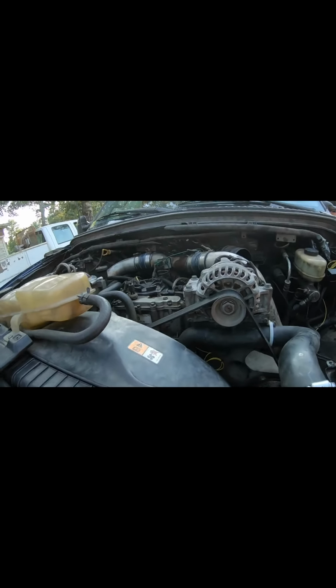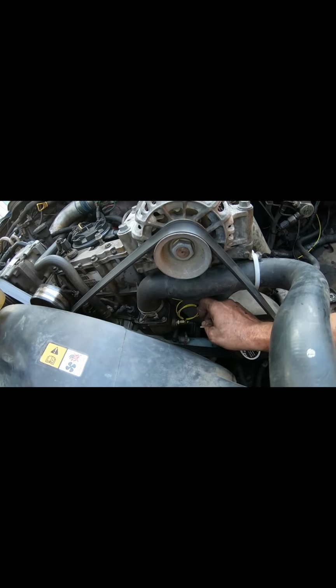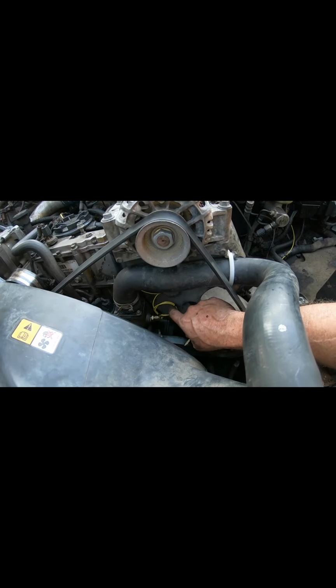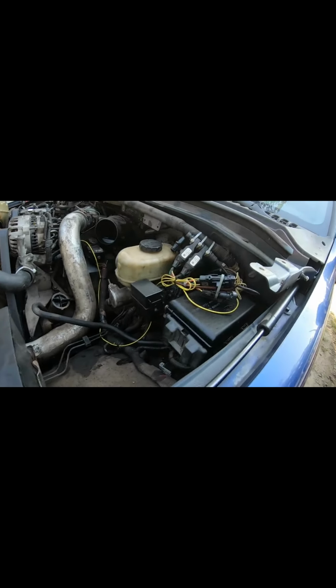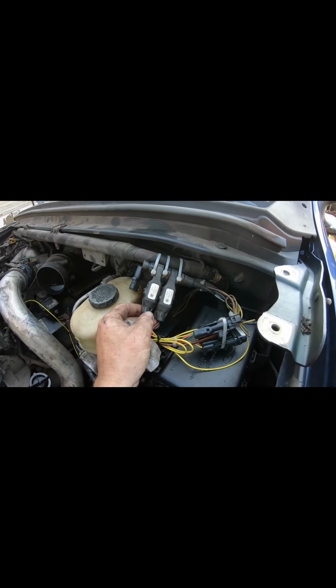Yeah, so there's my coolant temperature sensor I added. This loop of wire here, that's what we call a service loop. So if you have to work on it, if you have to cut it back for something, or it just needs more room, you have extra wire there at that end. And I got it run over with some of the other wires. And then over here is where this ties into that edge tuner.